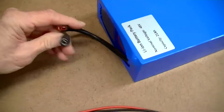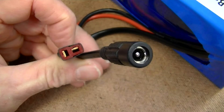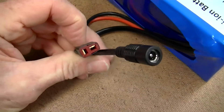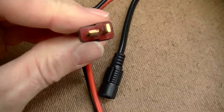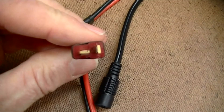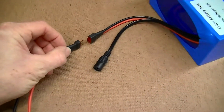The lithium battery has two leads: one for connecting your scooter's electrical system, and the other is connected to the battery BMS or battery management system, and is used for charging the battery. Each of these leads contains a red and black wire, though you can't see these individual red and black wires in this battery's charging lead, as they are jointly covered in a common exterior insulation. This battery ordered from dhgate.com came with a male connection lead that will be spliced into the scooter's electrical system. Depending on from whom you order your battery, you may not get one of these male connection splice-in leads. The steps taken so far in this video were done in anticipation of using this male splice-in lead, and later I'll show you what the connections look like for a battery that doesn't come with this male splice-in lead.